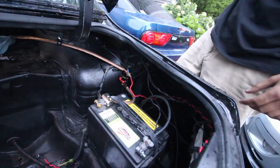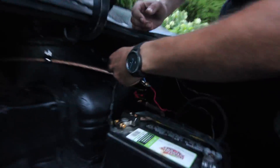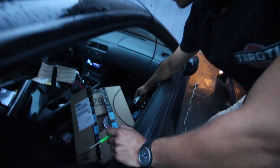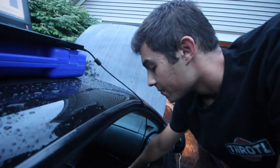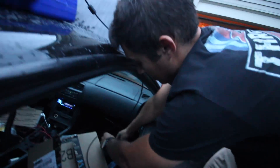Something didn't go great there — just a loose connection, no big deal. Actually, the fuel pump should technically... I didn't hear anything — turns out there's no fuel pump fuse in this thing. Okay, so we've got it sorted. Following Brad's instructions: turn that screw clockwise very slowly until it starts flashing really fast — as soon as it starts to flash really fast, just stop turning. There she goes — it's calibrated. Yep, it's calibrated.